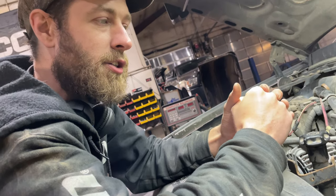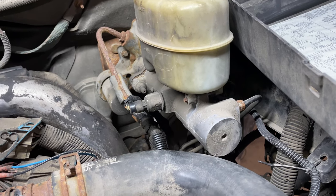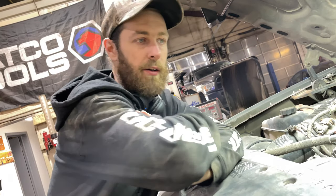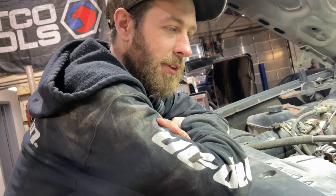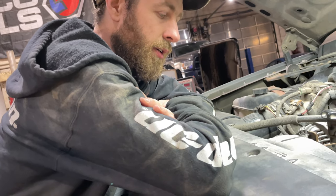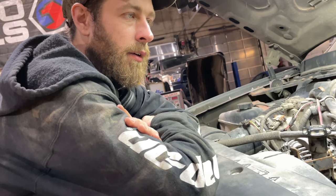The issue is there's no five-volt reference being supplied to my brake pressure sensor. That five volts is supplied by the voltage regulator internal to the ABS module. I'm basically at the point where I'm going to replace the ABS module. I checked powers and grounds and went through all the steps to make sure the ABS module is working as it should be, and checked all the fuses.